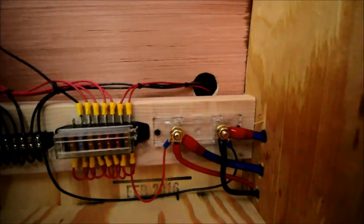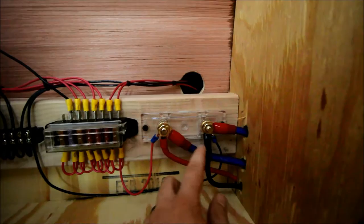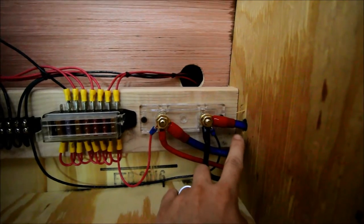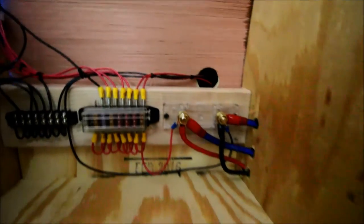I'm going to walk around and show you inside the cabinet. These are the battery cables coming up through the floor, coming in from behind my seat. One goes to one post, one goes to the other post — one just goes back to the frame for a good ground, and one goes to the battery. This red wire and this black wire come back around to the inverter, so I've got my inverter wired directly into those posts.